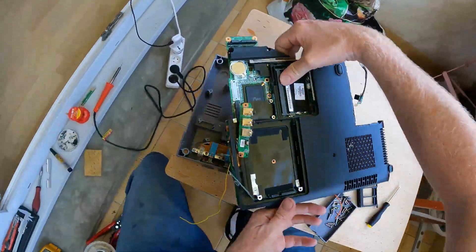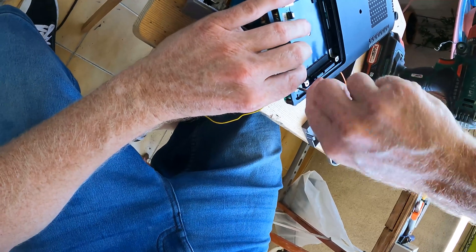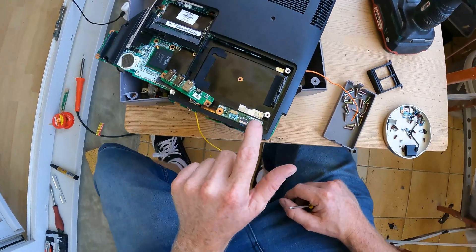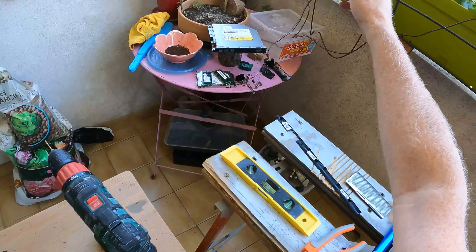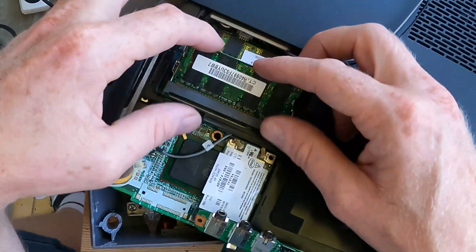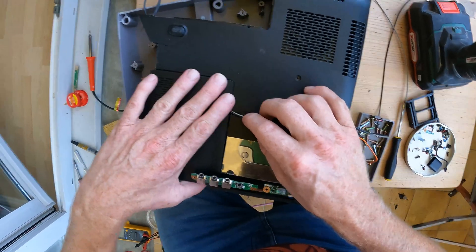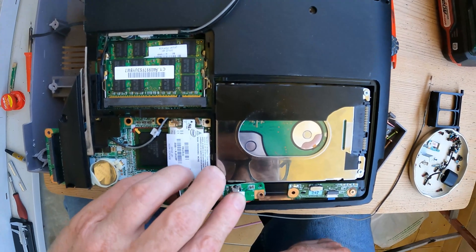We should mount those boards up too. Drill very lightly — you don't want it to bust through into the motherboard. Just about any screw will work on plastic as long as you drill the hole slightly smaller than the screw. As long as it's not touching the motherboard and it's not in the way of our hard drive, we can still turn our Wi-Fi on and off. I'm hoping the lights on this will shine into our power switch. Set up our Wi-Fi aerials. Let's get the RAM in — push in and then push down. Good old HDD — I'd love to put an SSD in this one day, but for now this is a zero dollar build.